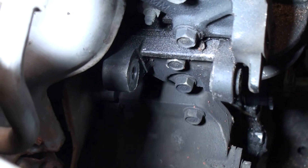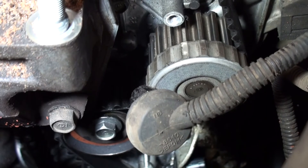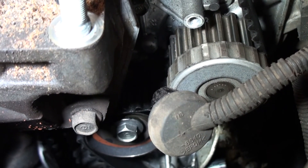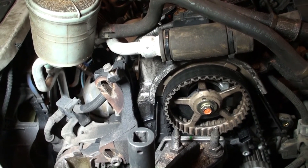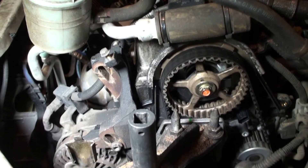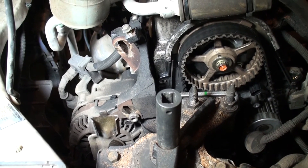At this point you've got a couple of bolts down there — once those two are removed, you have two more right there. There's one right above that you can see. Once I get these four bolts removed we can pull this bracket right on out and we'll have the access we need. I'll show you all the pictures in part two of everything you need to see for the timing marks and how to set them — same with the bottom. Let's go ahead and get the rest of this removed, and that'll be the end of part one.